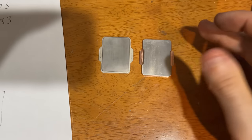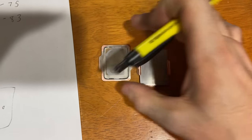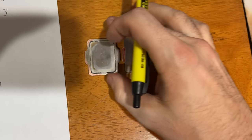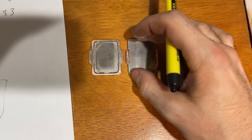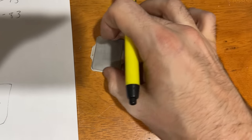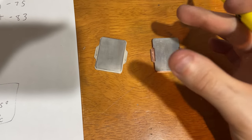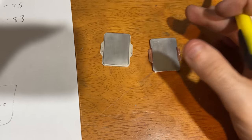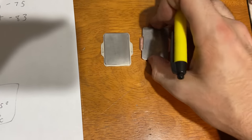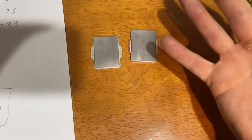But I figured that the results kind of make sense because of the die, if you want to look at this, the size of the die here. The total area between these two IHSs isn't that much different. Like, this IHS is more than sufficient to disperse that heat just from the size of the die relative to the IHS. Intel did a good job making this thing big and making it thick, right? So these were much more valuable in previous generations, but this generation, meh, right?